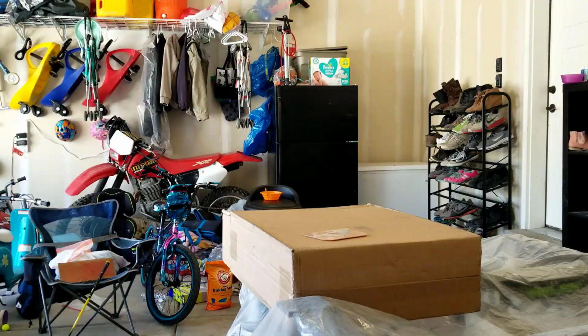So off camera, I came through and kind of vacuumed all the big dust deposits off and then went through with a rag and wiped everything else off. So it's cleaned off really well of the dust so far. I feel like I still have a little bit of sanding to do. I only blocked it at 220, so I think my plan is to do the body filler or the glaze putty, whichever I choose to do it in the certain spots, and then resand it all with 320 or 350 before we seal it. So that's the plan for now. So we're gonna just start knocking out all the little low spots and get this ready to go.